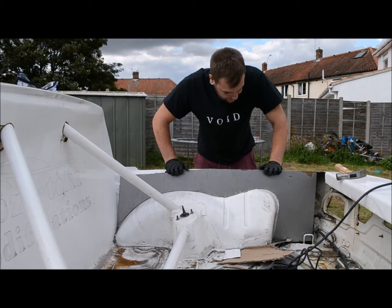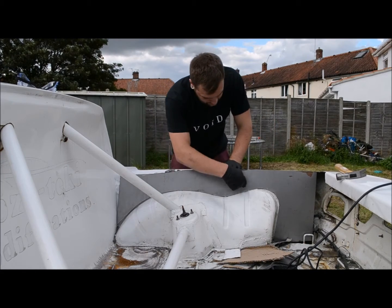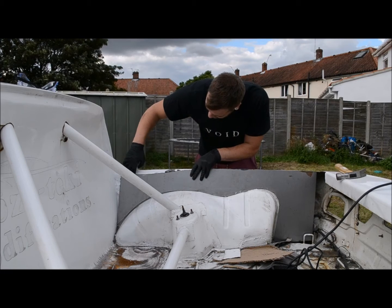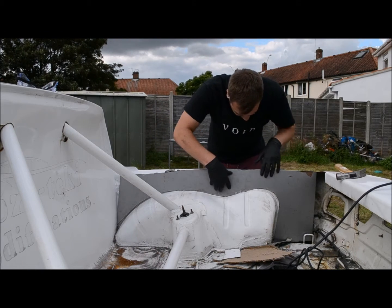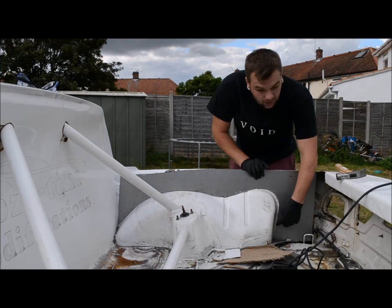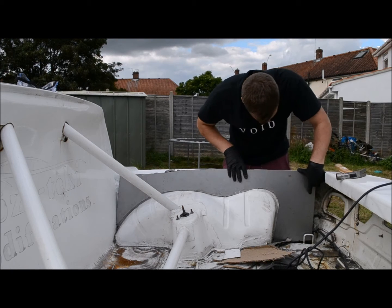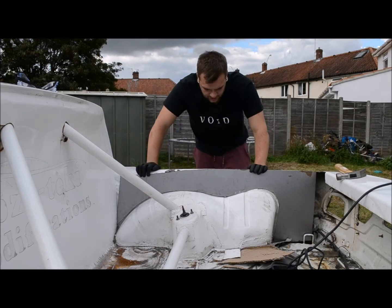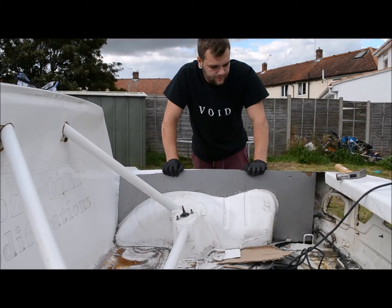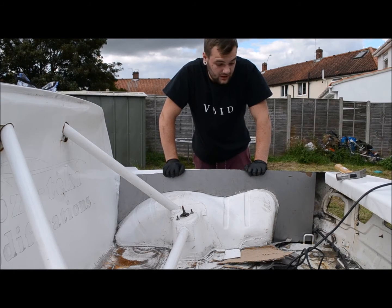Right, the bit of metal is all cut out. I'll just size it up so you can have a look. I have trimmed this bit here a few times to get into the arch nicely. If you look at the top of the arch on this edge it carries on along this edge here. This bit is a little wide, but when I grind it back I'll still get a weld in there okay, so that's not too bad. That's the other side — I haven't been attaching just yet, but it probably will be in the next clip.